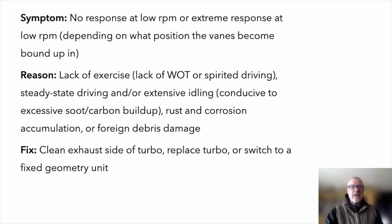What I did find is a good manufacturer-provided description of engine issues, especially injector failure and poor injector performance because of deposits. Deposits on the outside of the injector are generally caused by incompletely burned fuel that builds up around the injector holes. This can cause poor fuel combustion, poor performance, loss of power, and loss of fuel economy. Another manufacturer Q&A noted that lack of exercise, lack of wide-open throttle or spirited driving, and extensive idling leads to soot and carbon buildup — and that can be a problem.